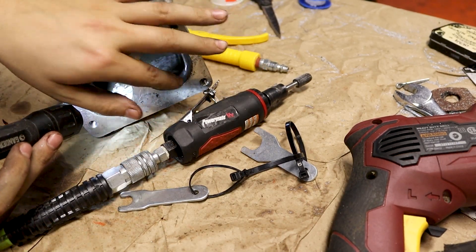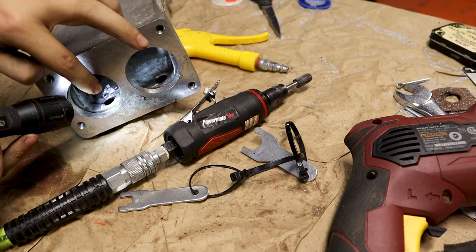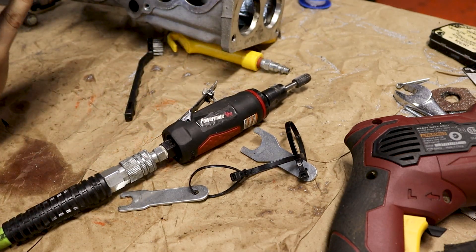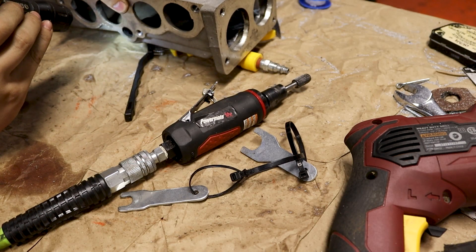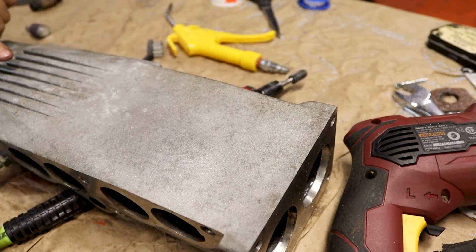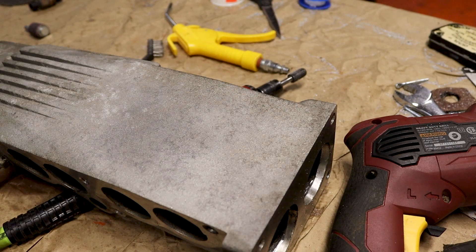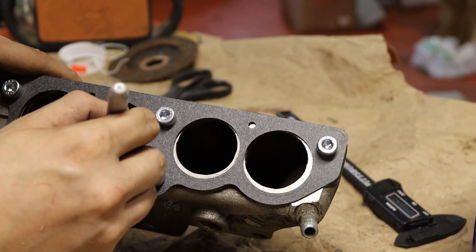At this point we've knocked down the main wall in front of the throttle body. What comes next is taking a barrel and smoothing everything out — making sure it's nice and not corroded, not gross, not covered in oil. Once that's done, we'll move to gasket matching the runners. I've got Arizona Speed and Marine runners going on this, and they'll need to be gasket matched. This is for a 91-92 car — you can tell by the shorter lines on top of the intake. The 88s had the lines match up to about here on the intake.